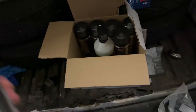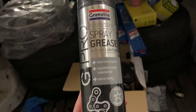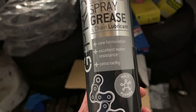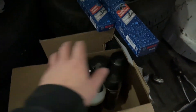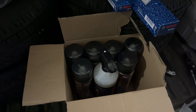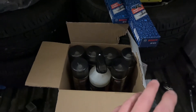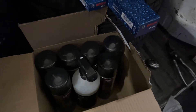With it being winter I was going to do the wax oil on this van, but the wax oil when it's cold just simply doesn't go on well. Luckily we haven't had any salt yet. So this stuff here, believe it or not, works just as good - it's extra tacky, new formulation, excellent water resistance. For an old van like this which is worth practically nothing, I'm going to do six of them to more than cover the underneath. It doesn't drop off, doesn't go onto the road, doesn't cause any danger to other road users. Doesn't necessarily kill rust like wax oil does but it does protect.